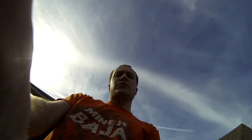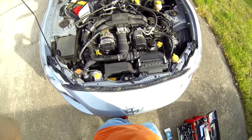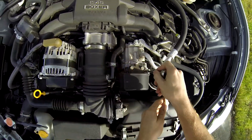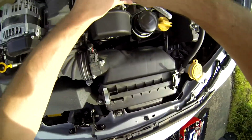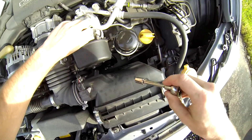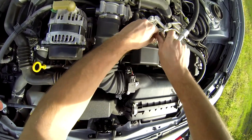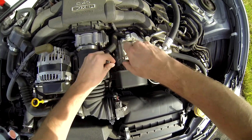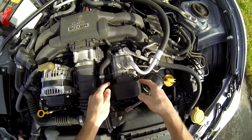A lot of people say you have to take the intake off to do this, but we're gonna try to do it without taking the intake off, cause that's a pain in the butt. It doesn't seem like you need to unless you've got fat arms. We're gonna take these covers off and watch out for these little plastic clips that are basically designed to break so you have to buy new ones — we're very careful not to screw them up. We have a magnetic parts tray as a place to put these. It looks like we have some metal inserts, so I'll have to source those on McMaster-Carr after I 3D model it.